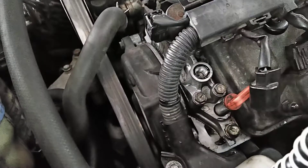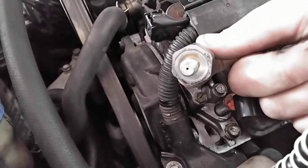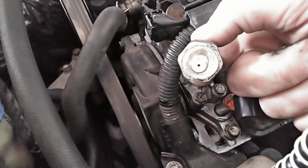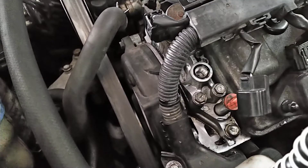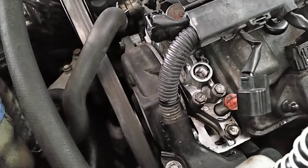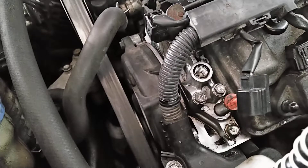Just like that. The problem is that little hole gets gummed up. If you ain't changing your oil regular, or you got a little bit of sludge, dirt, debris — anything will plug that hole up and it ain't going to register pressure. That's what's going to be the problem with getting the oil pressure in there to activate and deactivate your solenoids.